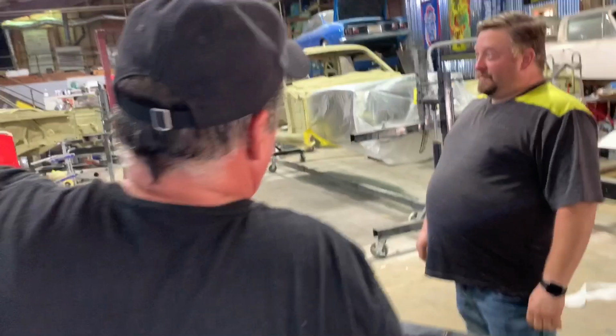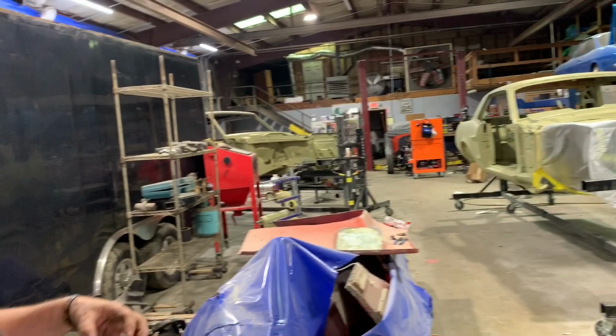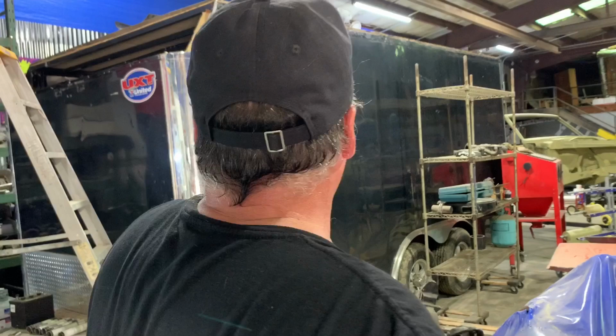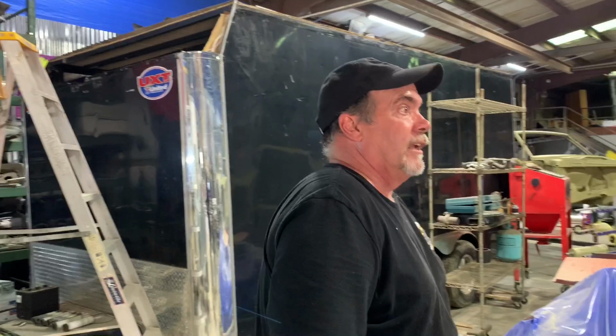This goes over top of that metal. So I'm going to get up there and mark where the holes are so I don't reuse them again. You don't want to reuse the same hole now because I couldn't find number 14s. I could only find 12s long enough to go through metal, wood, plastic, and into that metal. It's a piece of extruded aluminum that goes over it, and you screw through that and then in this. So I'll get up there and mark all that. These tuck in behind there. That's really the only part that goes inside anything. Everything else just sits on the top.